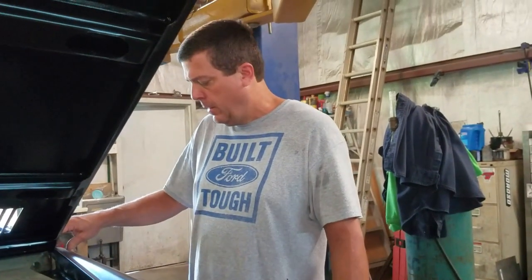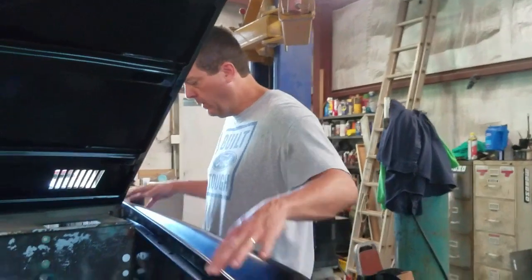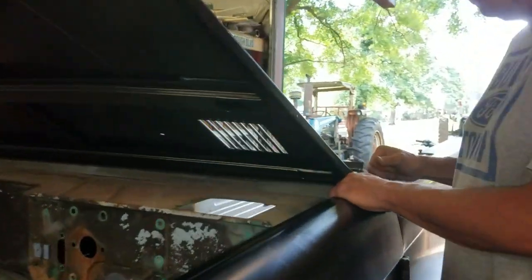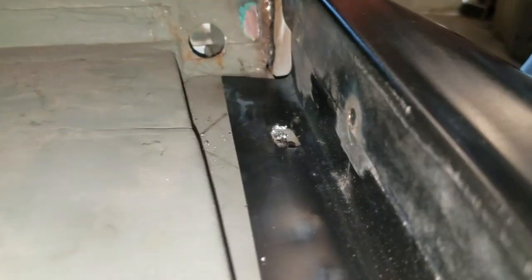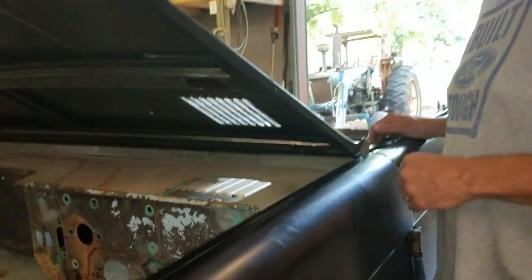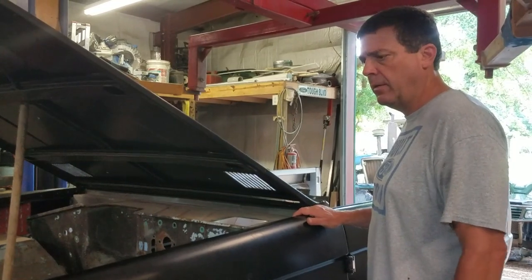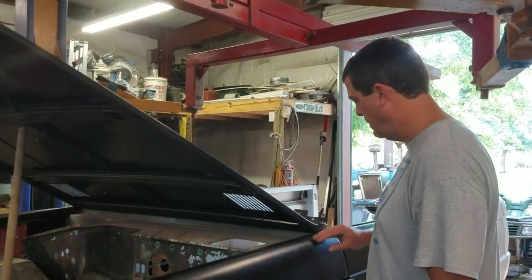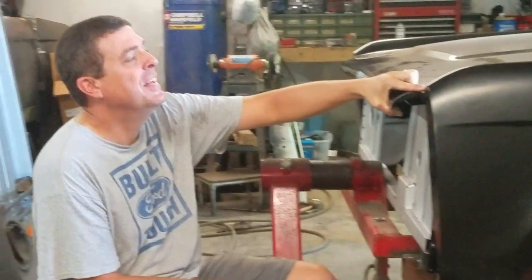I'm going to lock the back of the fender down to the apron and down the A-pillar first, get it locked in place, lock the front, and then I'll pull these bolts down. I forgot to drill this bolt hole. Nick, one of our subscribers, was asking about it — I repaired this bottom portion so I have to make the hole. He was concerned with a hole on the part he bought not lining up with the fender, and I think he had that confirmed by the factory. I'll get more information on that — it was an aftermarket part and apparently they have the holes drilled off. Big surprise, right?